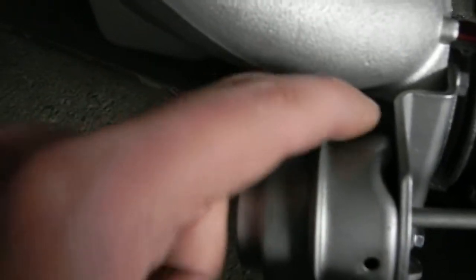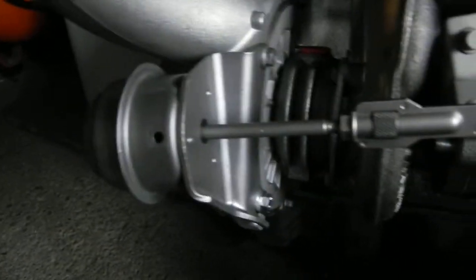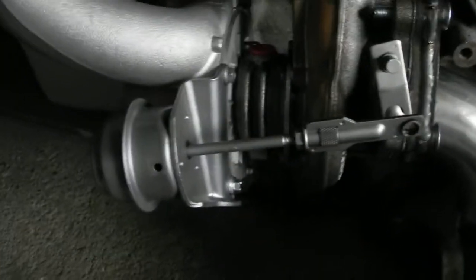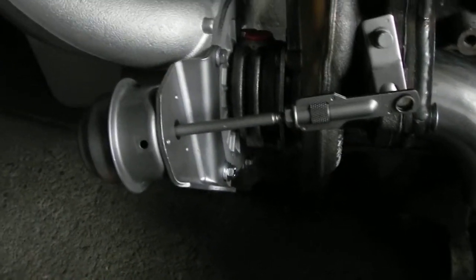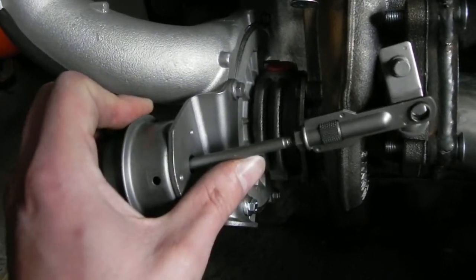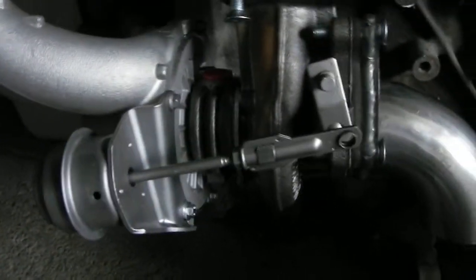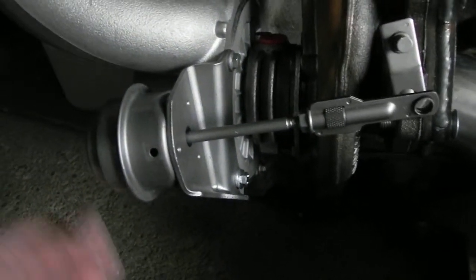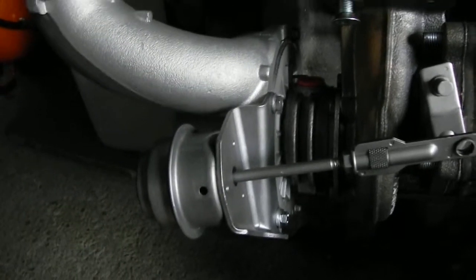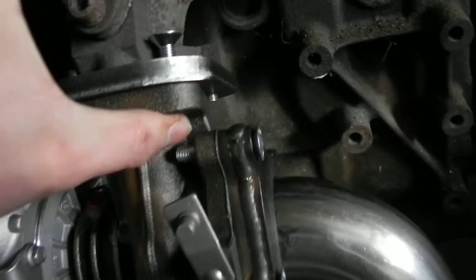With the nut or the washer we can also adjust the pivot point or raise the activator a little bit higher, because we still have enough room for play. All in all, not a big problem — should be very easy to get this done without using the vacuum activator and instead using the old GT15 activator from the old turbo.